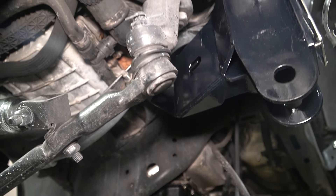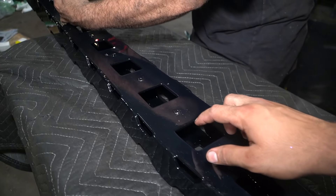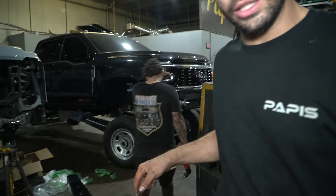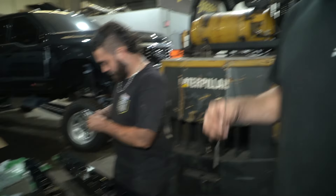Another big part of putting these stainless overlays — probably the most important part — is you want to make sure you get all the powder out of the threads before you put your hardware in, so you don't end up with a cross-thread or a screw you can never use again. Remember, we fasten stainless with stainless hardware. Do not use an impact gun on the stainless hardware. Once you feel resistance and the impact starts beating on the stainless, the nuts welded on the back are steel, and you can cause the stainless head to actually seize in the part.